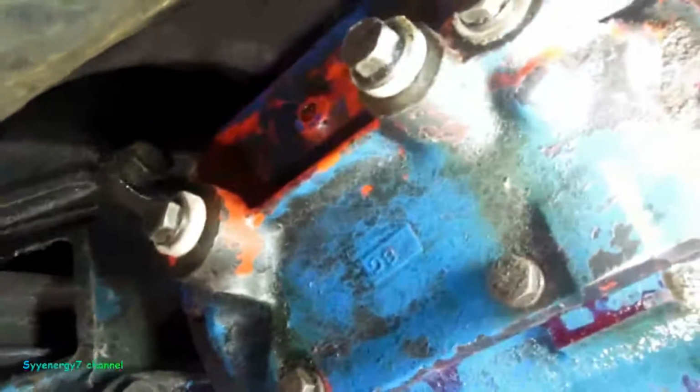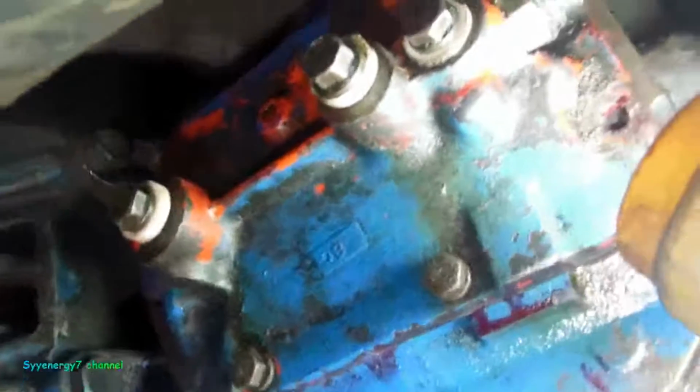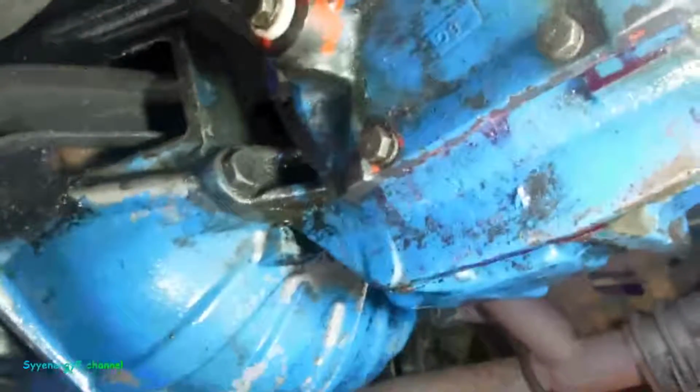Well, the side cover's up there, as it should be. So get some blue Loctite, put on the bolts, and we'll secure them down. Well, that's a wrap. They're all Loctite blued on there too, all the bolts. So I don't trust nothing. And the backup light thing's back on there. Tomorrow I'll do the rear seal. I won't put oil in it right now. I'll just leave it up on the jack. But that should be good, because I use that stuff too. And I really got the gasket surface squeaky clean.